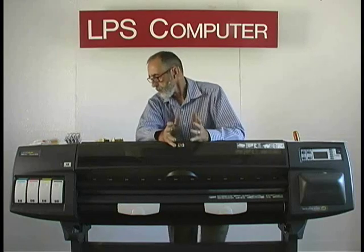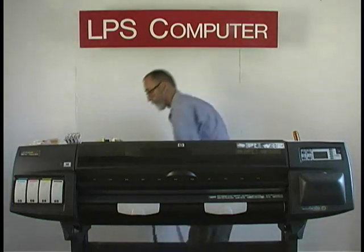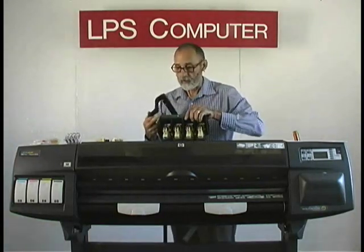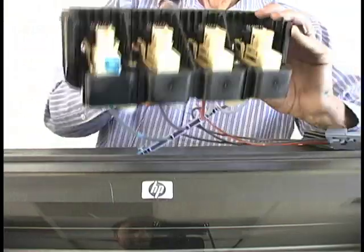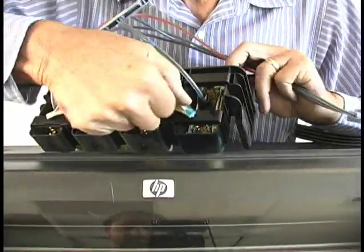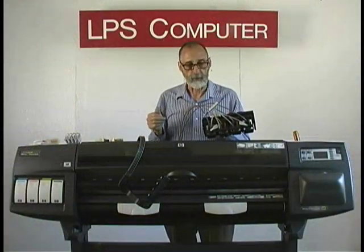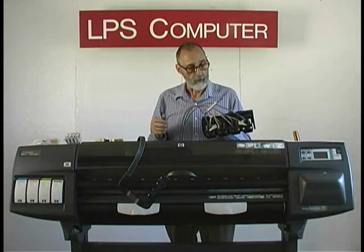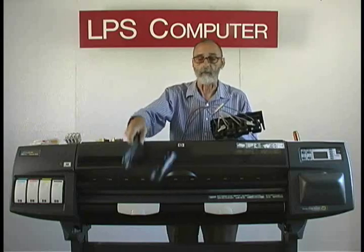It's very possible for air to get in without ink getting out, because of a check valve failure. I will show you a failed system right here. One is on the input side where the ink cartridges are put in. These are actually valving systems and they've got a check valve of their own. You see this one has leaked in the cyan. There are O-rings inside here that dry up and fail. It's more a function of time than it is of wear. They're made of synthetic rubber - they just harden over time and crack.